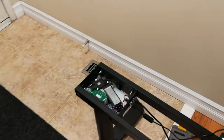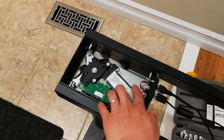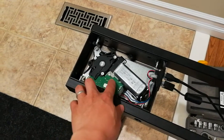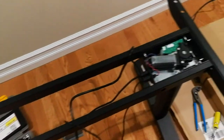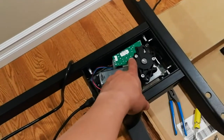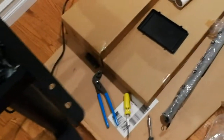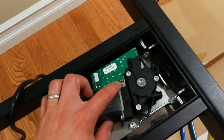So here's how you actually fix it. You should take off the plastic cover, then you can pull off the motor. There's actually an electrical connection between the board and the motor. What I discovered is that on the side that's lifting faster, the electrical contact between the board and motor is very very loose. So I just take my pair of pliers and squeeze that little contact.